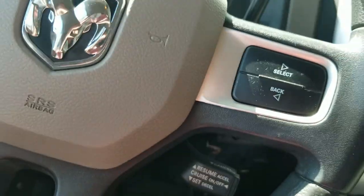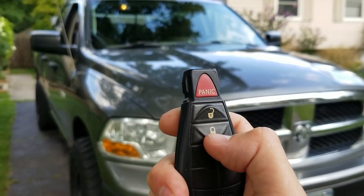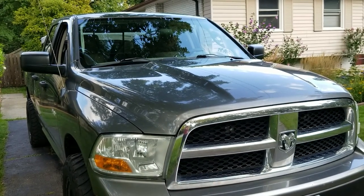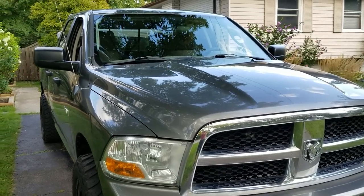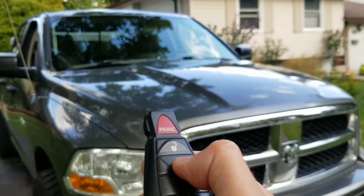Let's see if hitting the lock button three times turns this on — maybe the door needs to be shut. What's important is just getting the timing down correctly with the remote. You don't want to hit the lock button three times too fast or too slow, otherwise the truck won't start. Basically just every half second, hit the lock button so you get three consecutive beeps, and the truck will start after about a two-second delay. So to start the truck, hit the lock button three times with about a half-second delay between each hit. One, two, three — and then it takes a second to enter start mode, and it starts up. Hit it three times again to shut the truck off: one, two, three — and the truck shuts off.